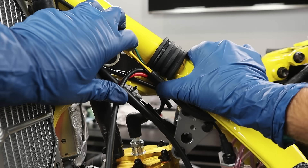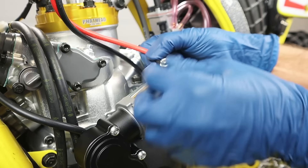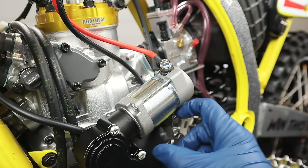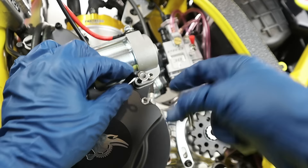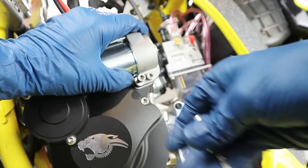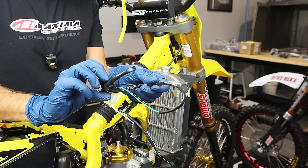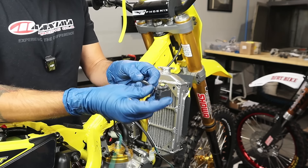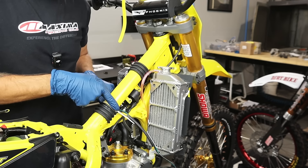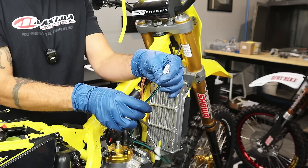Now that we have good routing, we can connect our positive cable first. You always want to connect negatives last when working with a DC system. Go ahead and get down below, sneak this through, and get it connected to the starter motor casing itself. You may have to bend your ring terminal so it can sit nice and flat or square against that housing when everything is bolted back together. Give it a little cinch — not too much for now, since we'll be changing these out for black hardware. We are almost done with this install.